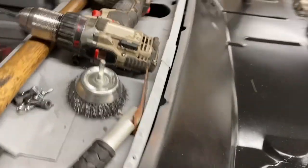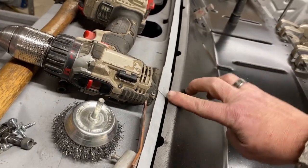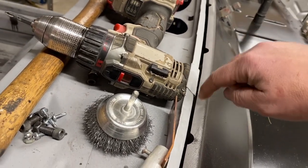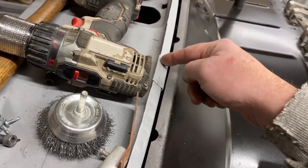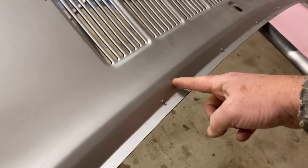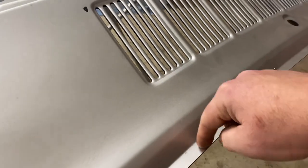The upper cowl will come down here and then comes up, and it will have two series of holes that I put in it. One will get spot welded through onto the lower cowl, the other get plug welded, spot welded through onto the frame of the windshield. And that is this V right here. So I will have to drill holes here and drill holes here.